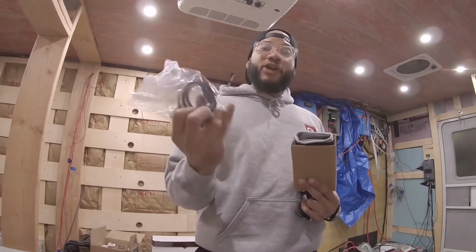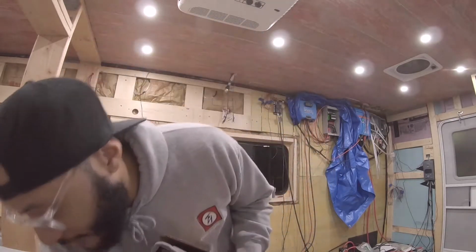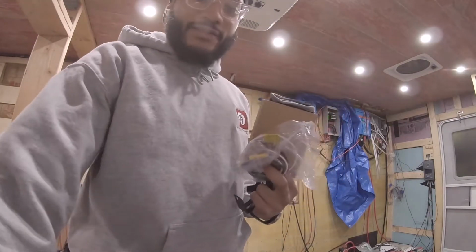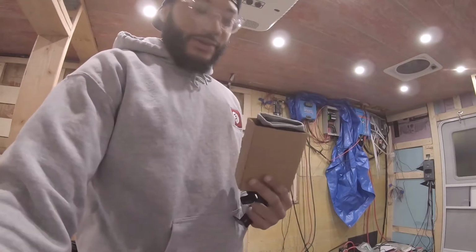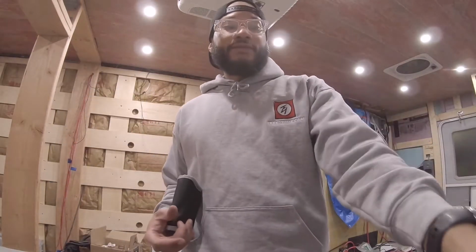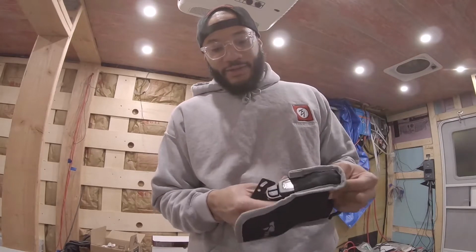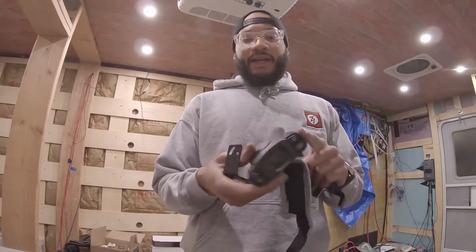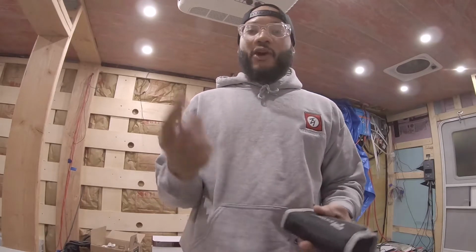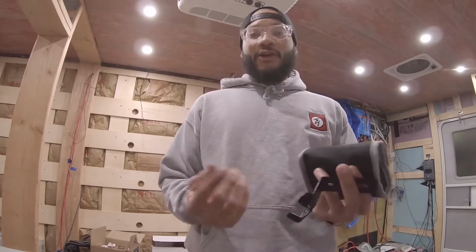the wire harness that I have to hardwire because my vehicle isn't pre-wired for a brake controller. So I have to do a hard wire where I have to run the wires and find where everything goes, which isn't too bad. You just have to verify your pinouts for everything. It has the mount, and the controller itself comes with a little pouch. So depending on how you mount it, you can take it with you or have it hard mounted where you have to physically unscrew it to remove it. I'm gonna hard mount it.